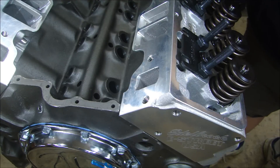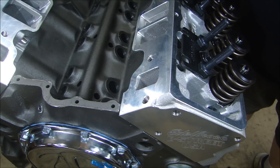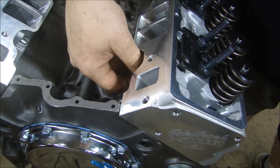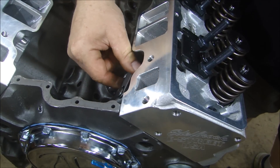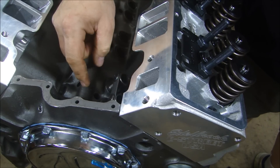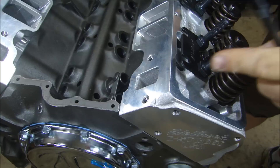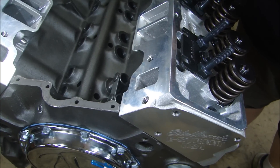I'm going to put this in — first thing I have to do is put some lifters in. And yes, I know we owe a video about the history of lifters; I'm working on that, it's not as easy as you think. Remembering that cylinder one is on top dead center, so I know my valve will be shut here.